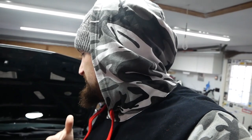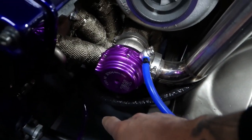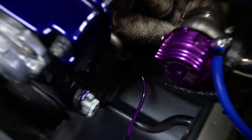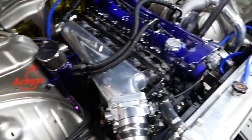I have plenty of wire to use as grounds. Today I'm probably just going to make sure everything is grounded nice and good. There's another engine ground here — actually two coming off that same point — but maybe the point on the car it's connected to isn't the greatest. I might try to put one straight from the starter to the frame, in case the transmission-to-engine ground isn't getting a really good connection.